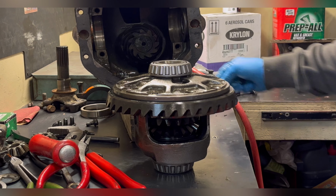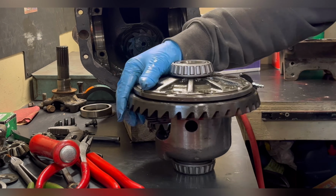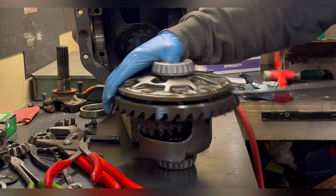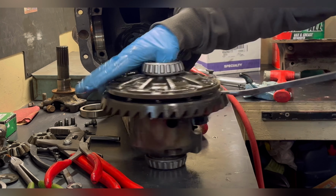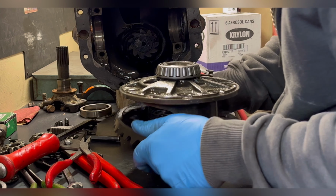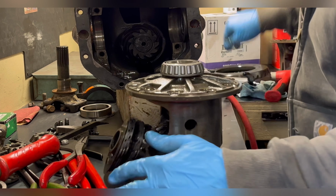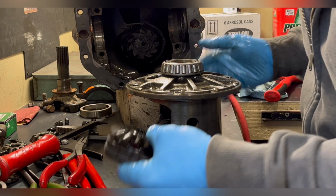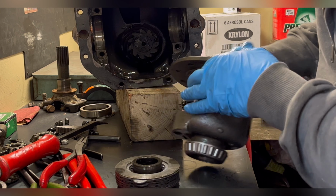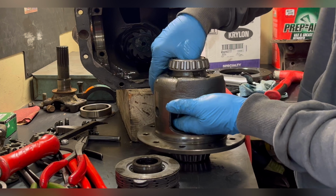These are the clutch keepers. You can use a mallet to start working the ring gear down, then you can use a pry bar and work it down. Just don't want to use a hard hammer. Pop the ring gear off and set it aside, the side gears will literally fall out. There's enough room in that window. Try to keep them left, right oriented and keep the clutches on the side gears they came out of, at least until after inspection.